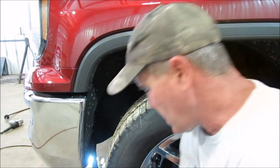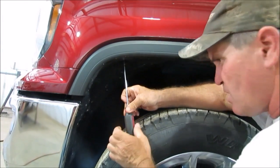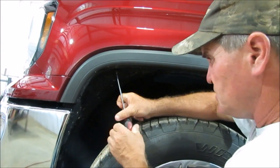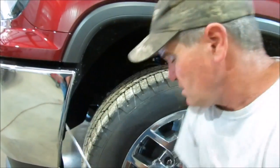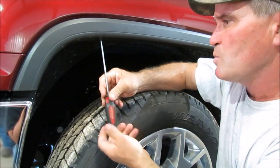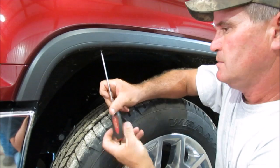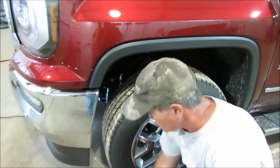The reason you're taking that plastic off is you have to get straight up above — you have to take that plastic off to get to the bolts to remove the chrome bumper. Unfortunately, they put a lot more parts on it after the chrome bumper was put on, which you've got to remove.